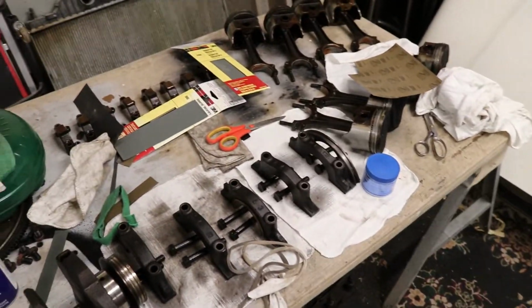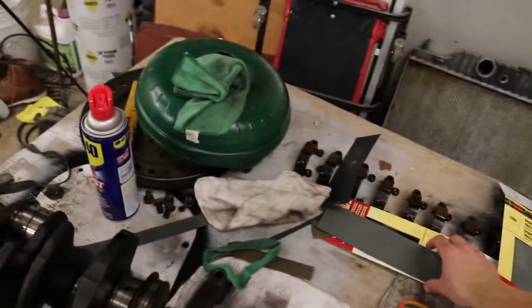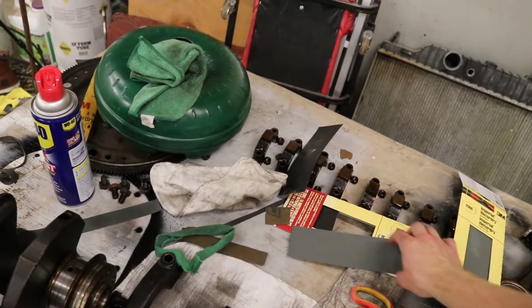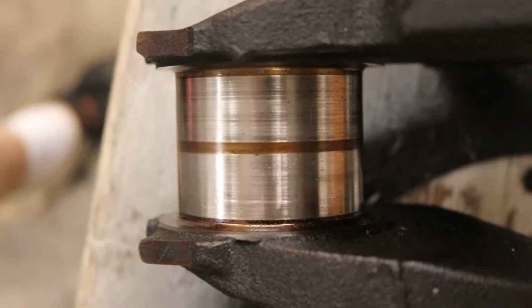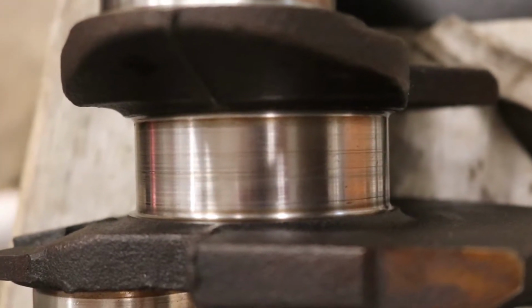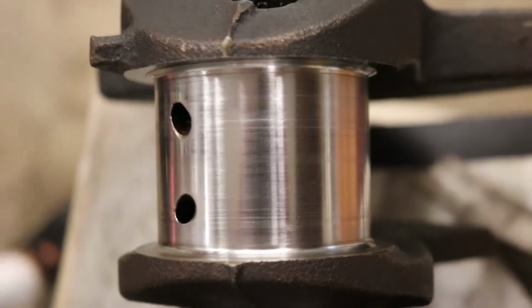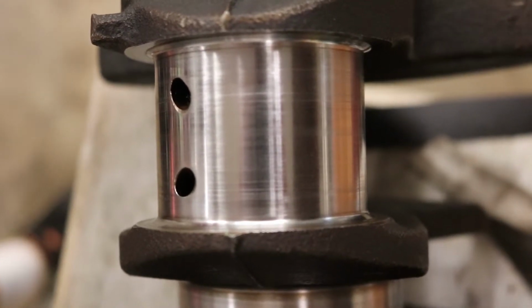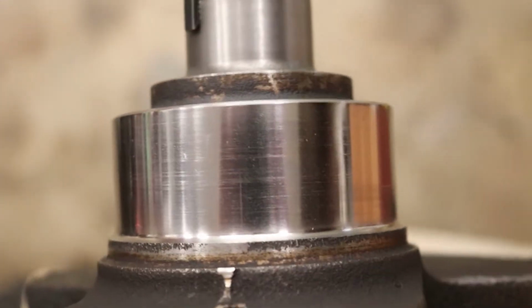Alrighty, everybody, it has been a little while. I just realized I'm out of 800 grit. I'm also pretty tired. I don't know what this is, that's 2000. I have a little bit of 800 there, but not enough. I ended up going up to 2000 on this, so as you can see, you got that one not done. That one I need to do a couple more 400 on. I haven't done anything else. That one I'm finished doing 400, so I'll move to 800, then 1500, then 2000. And that one I'm done doing.